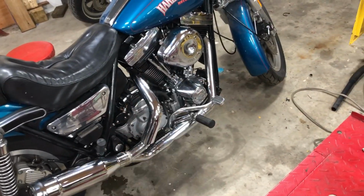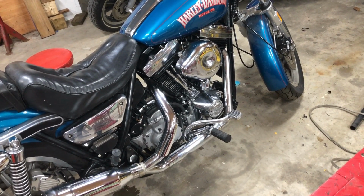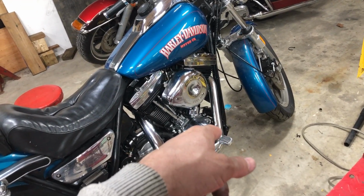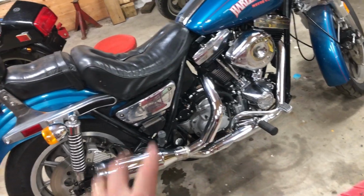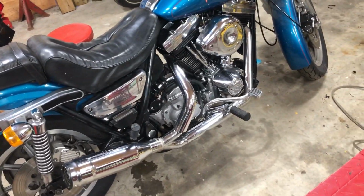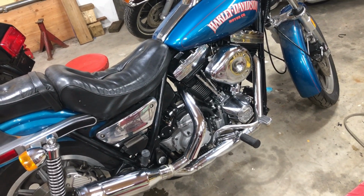Oh yeah, and the ignition system. Had spark, had it running, and then the ignition was screwed up, and I think I put a new coil on this one too. A new ignition coil and the Ultima ignition system. The other Ultima ignition system was from like the 80s or something, early 90s, and it had 2 separate adjustments for front and rear cylinder, and it was screwing up, so I just put the new one in. All new oil lines on this thing. Changed all the fluids and oil filter.